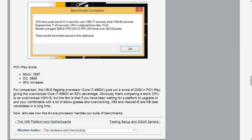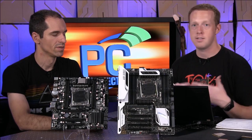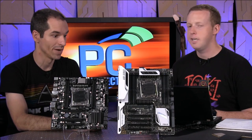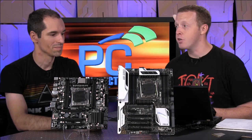I'm using a Corsair H100i — a 240mm two-fan self-contained water cooling kit, a very consumer-friendly solution. It's not like I did custom loop radiators or anything like that. You don't have to roll your own water cooler. But if you have a lesser off-the-shelf water cooler — like a single rad, especially single thickness — overclocking becomes an issue.